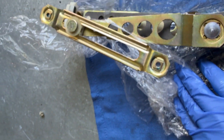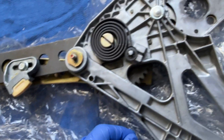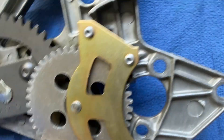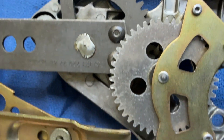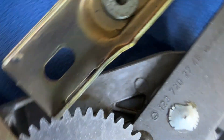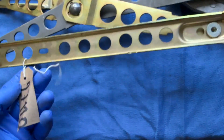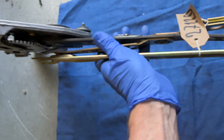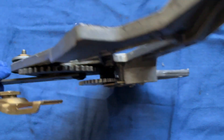As always, the regulators are the most likely thing to fail. I've actually ordered a front left regulator from the UK because I didn't want a driver's side from the US, which would be heavily worn — you want to use a passenger side where they're rarely used. You can see this regulator part number for a front left. The new cost from the Classic Centre in 2024 is $1,000 for a regulator, and I think it's special order. I got this for a few hundred dollars.